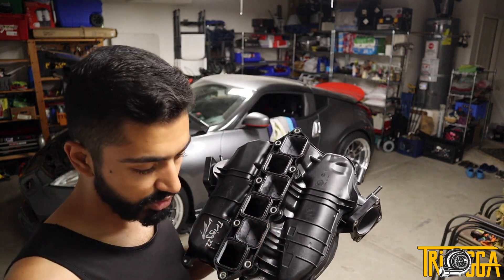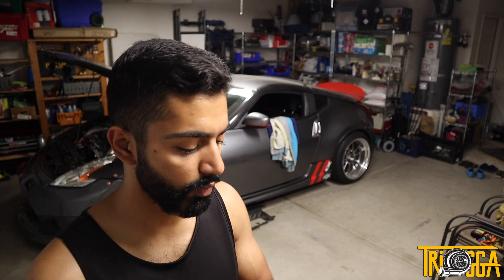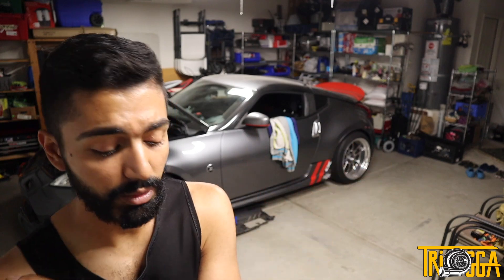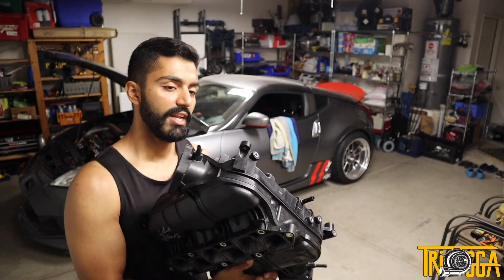I took out all the excessive plastic on the inner slopes, then used sandpaper in different grit numbers — starting with a lower number to remove the extra plastic, then 80, then 220, then 400 or 440. We smoothed it out. For the throttle body mounting tips we used a flappy disc to smooth out the inside, and everything came out nice.